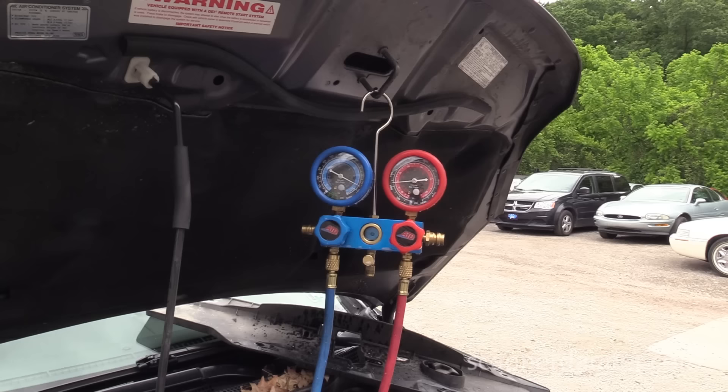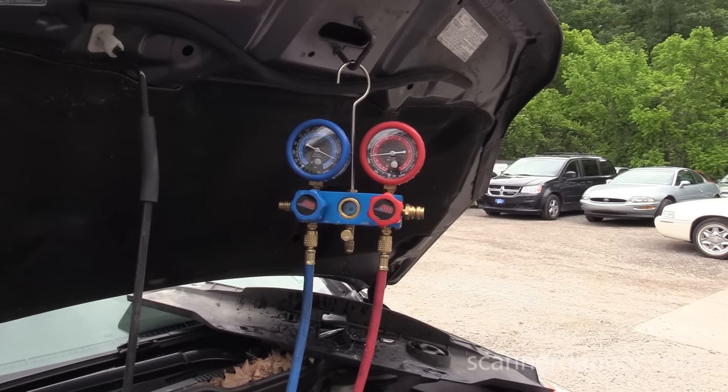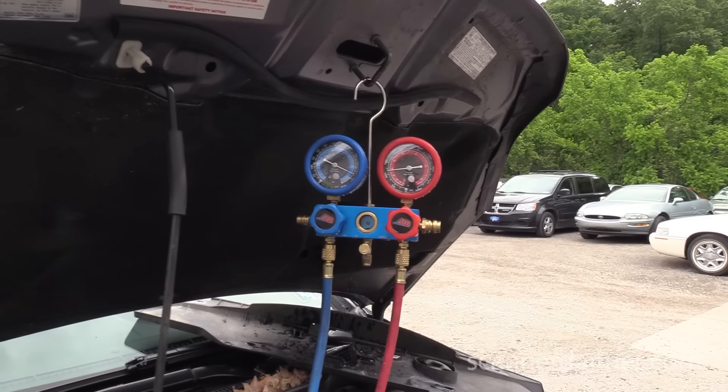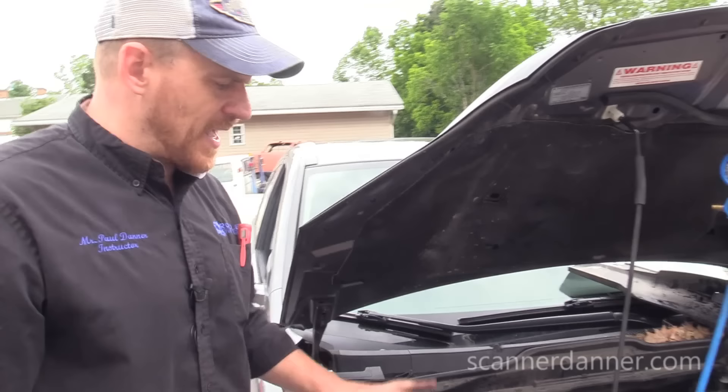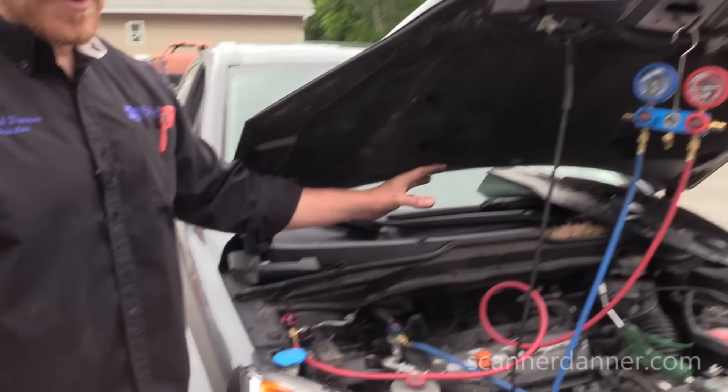Because an EVAP core that's leaking — I don't really think that pressure and vacuum would alter that leak, because it's a metallic hole in a component as opposed to a shaft seal that's exposed to varying pressures, one being a vacuum and the other being a pressure. We're absolutely leaking. So I want to emphasize: if you can't find a leak anywhere, don't forget about your service ports. We could have a leak there that you're covering up by connecting your gauges.